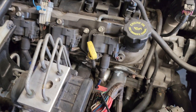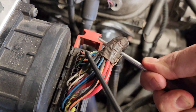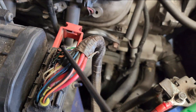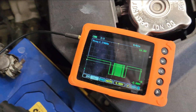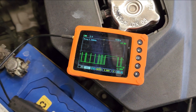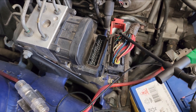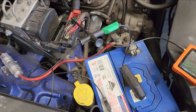So let me get a screwdriver — something I prepared earlier. Okay, so we are completely unplugged and our signal is still there, so pretty safe to assume that we've got a faulty ABS control module, which is pretty normal on these things. So speak to the customer and we'll find out what we can do.